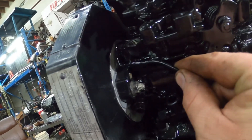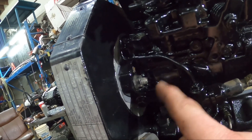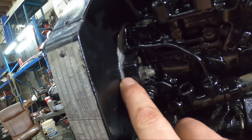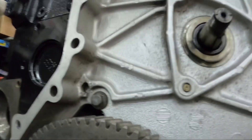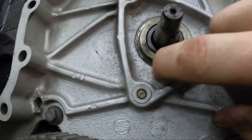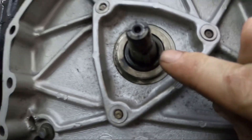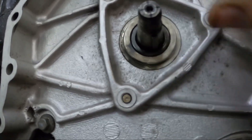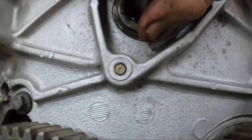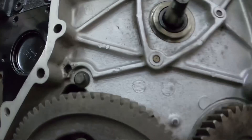I personally just pull those pins out right away. Usually when you get the pump back, this plate here will just be hanging off a wire — you pull the pin out, put the plate in, put it back together. So if you have this mark lined up here on one side, on this side look at the keyway — there's another little line right there. Your keyway wants to line up with that. I'll have to move it over just slightly to get it aligned.